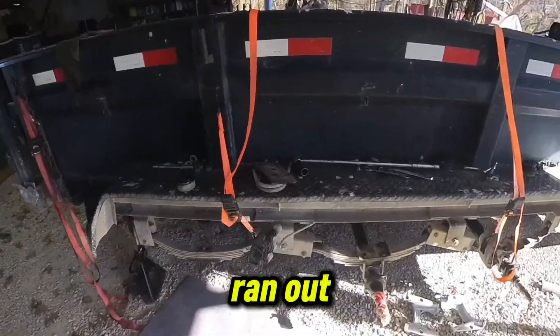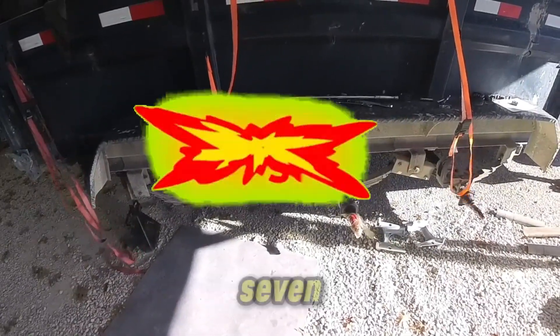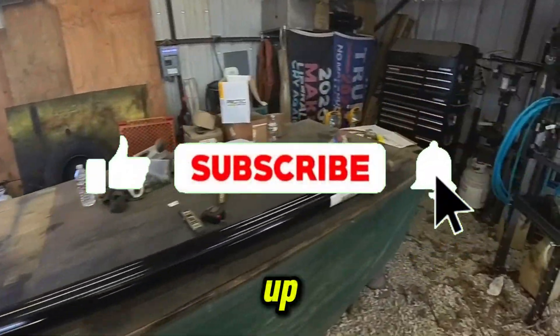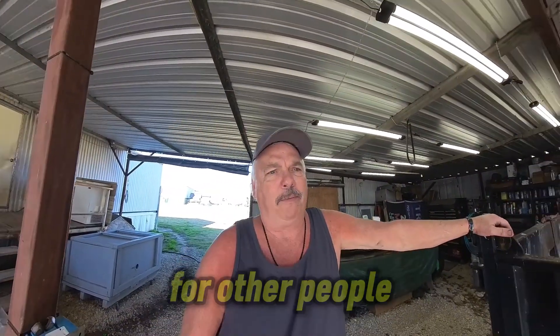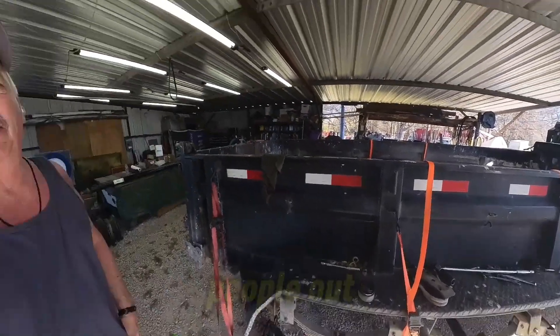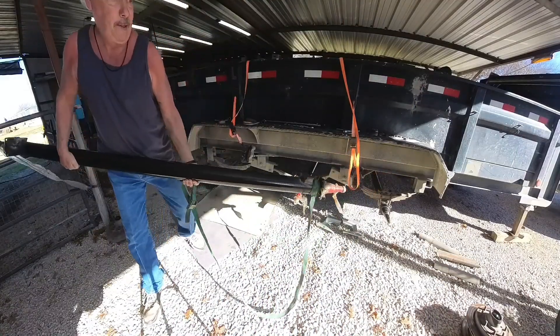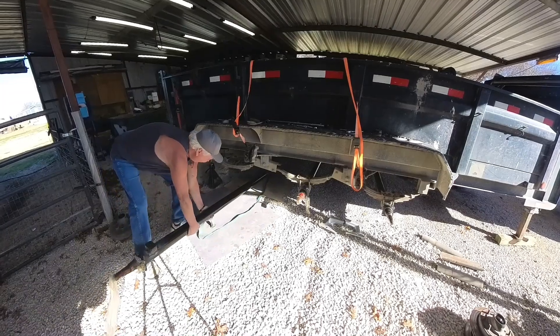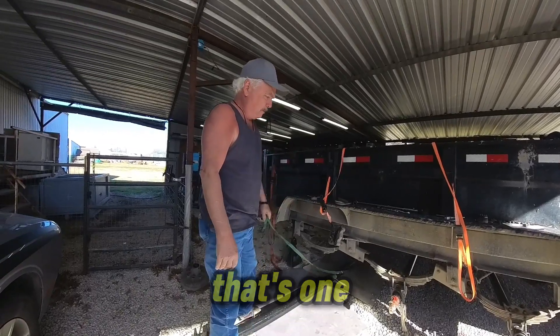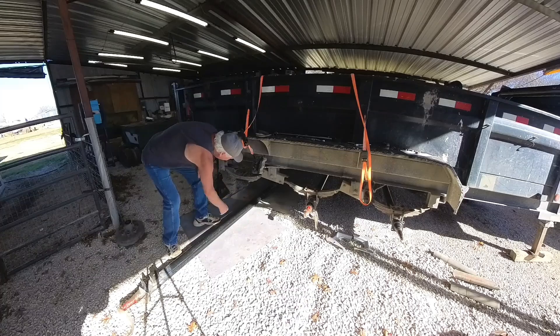All right, it's another day — ran out of daylight yesterday putting these axles on. We flipped them, putting the 8,000 pound axles on versus the 7,000. We've got one more to put into place and we've got to weld it up. Now, if any of y'all watching have any helpful hints for other people who want to learn how to do an axle swap on their trailers — whether it's a regular trailer, dump trailer, or RV — put them down in the comments below. One thing I learned: put a strap on the other end when sliding that axle in — that's one of the hardest parts of the whole project.